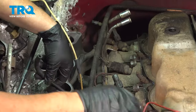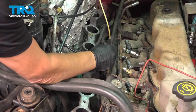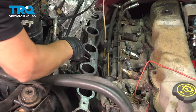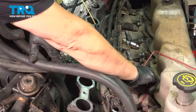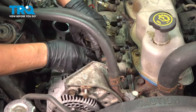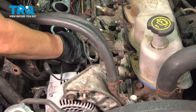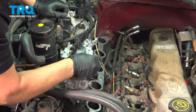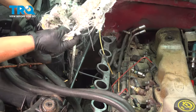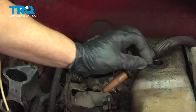Run these vacuum lines underneath in the opening. Put the regulator vacuum line on. Make sure you grab all your vacuum lines and get them preset before the upper intake goes on — you don't want to fidget with them after. Now with the harness all in place and fuel lines in place, put the actual fuel lines on the injector rail and connect those.